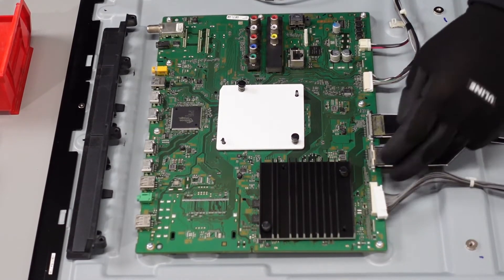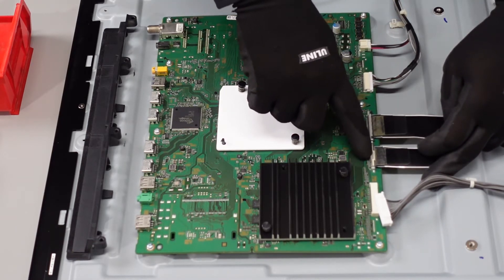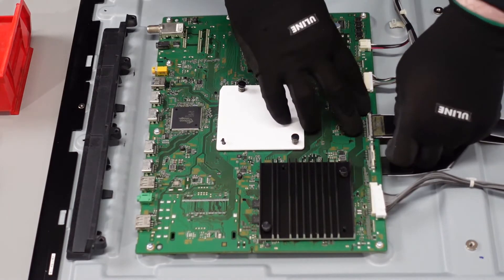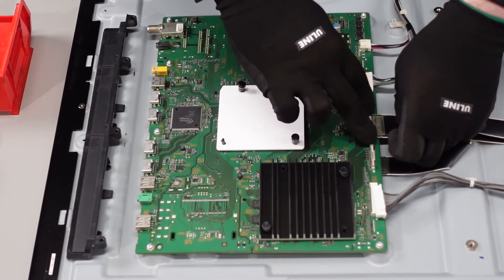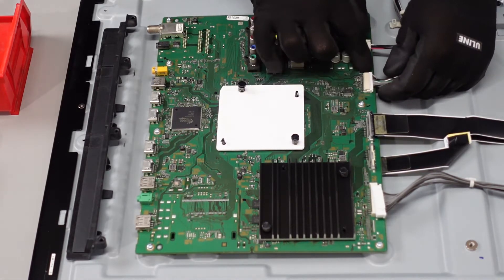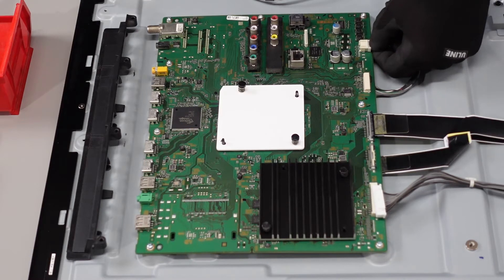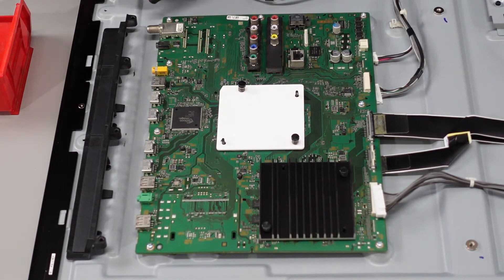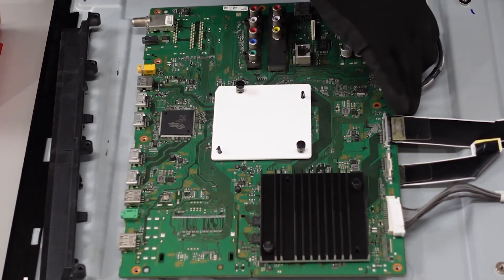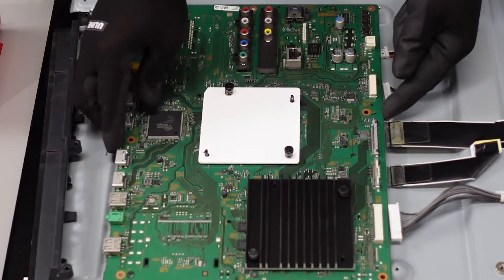Walk the first clip very gently away from the board. The next two are important — depress the small tabs on top. One has a small cream-colored tab along the top of the plug; make sure that's fully depressed before removing that cable. Another has small plastic tabs on the right and left side — push those down at the same time and slowly walk it away. The next one, pinch down on both sides to release the clasp on left and right. The last one, push down the tab with your thumbnail and it comes right out. With a handful of screws removed, the main board lifts away — there is a little bit of adhesive underneath, so use a little force, not too much, and it comes right away.